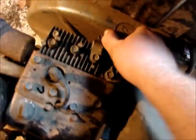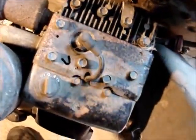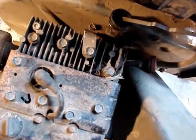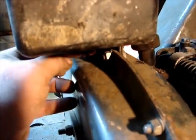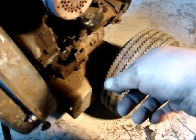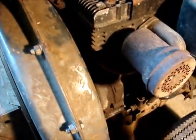She's all back together. Let's see if it'll start. Check the oil here — nice and clean. It's about an eighth of an inch down but it's in the good mark, though I did have it tipped back. This little fuel valve is up under here, which is really a pain to open. It's definitely not been run, so we will choke her. This thing usually starts good because it's got a really heavy flywheel — you get her pulled over and it just goes and goes and goes and it'll usually start. Not always.